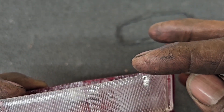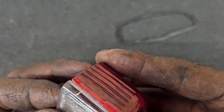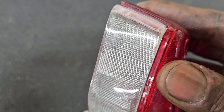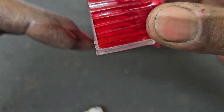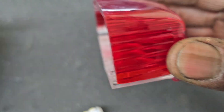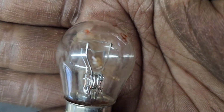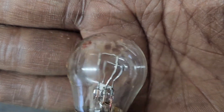There is an exit actually drilled into the taillight lens, so if water did collect in here, not only would it come out the actual holes and cracks in the lens, but the actual light itself does have a way for water to exit out that way. On the actual light bulb itself — my camera work isn't very good — but you can see there's like melted plastic on the light bulb itself.